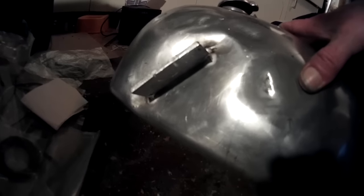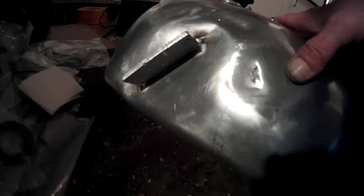Got the major dent out — this was the golf ball-sized dent on the back end. I thought it was not going to be easy to pull out, but it came out really, really nice. I just have a bit of TIG welding to do up here, maybe put another rod on and do another slide hammer job to pull out this edge. The dents here are gone completely, and the heavy scratches that were evident — you can see them on the front still — those are gone.